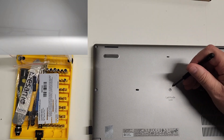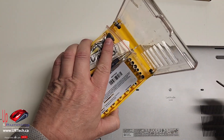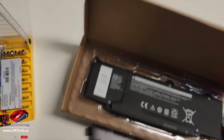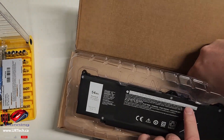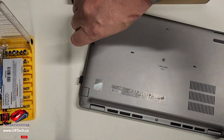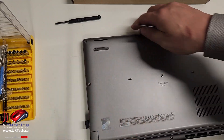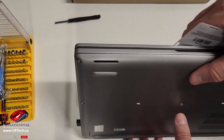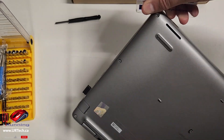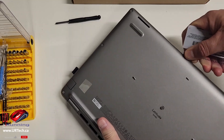Not very challenging. First thing you need to do is pull out the screws. You can see we do have specialty tools, but you don't need to use them. In fact, the replacement battery we bought came with screwdrivers. Now we just have to take the back off. The way you used to do that was look for a pry point, but they don't use pry points anymore. So you have to take a credit card or something small and thin, jam it in and pry it around. There we go — just slide it around.